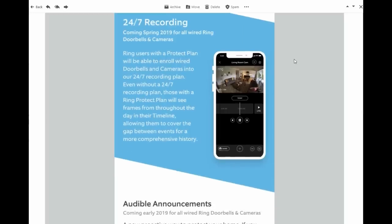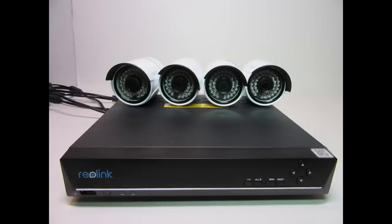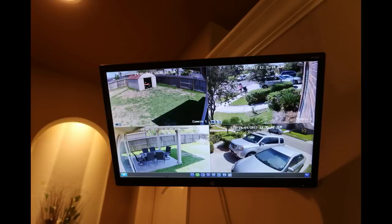Then the 24/7 recording, which a lot of you have been waiting for. This feature will hurt Nest big time because it is the feature they are known for and one of the top reasons why people buy Nest cameras. This is an additional fee on top of the Protect plan you're subscribed to. Personally, I don't like 24/7 recording on cameras that upload to the cloud because it will use a lot of bandwidth. Just imagine if you have 10 cameras streaming continuously — add your Netflix and online gaming and this will definitely slow down your internet. Your internet provider will also cap your bandwidth usage and probably throttle your speed, especially in peak hours. If you want 24/7 recording, you will be better off with an NVR camera system, which records uncompressed video footage on a hard drive and will not waste your internet bandwidth.